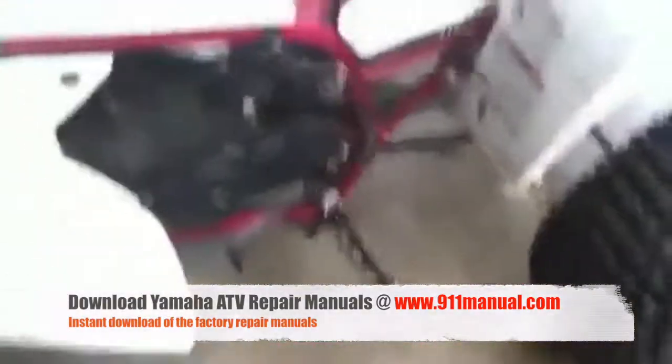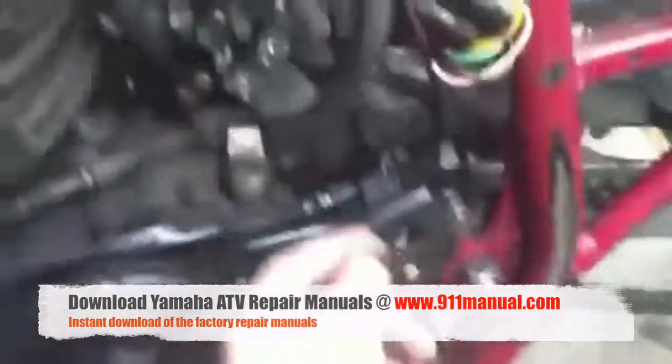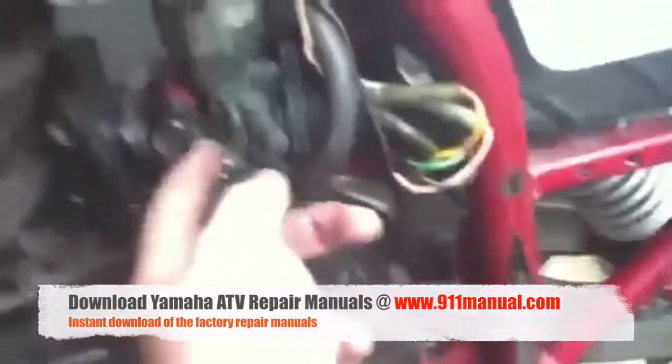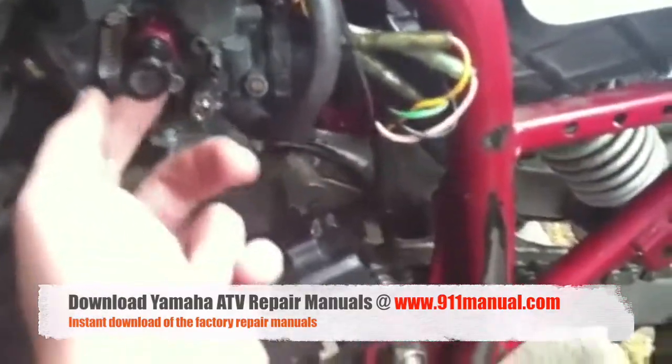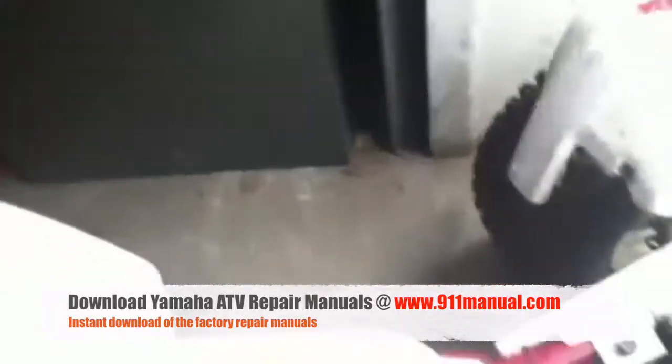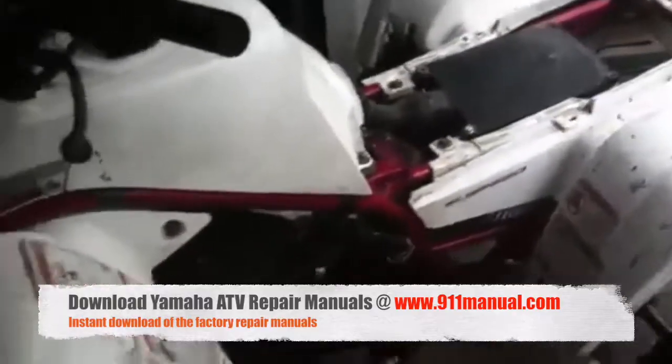Here's my blaster. I found out that when I would start it up and hold out the choke, it would be pissing air from somewhere — it was from here, because the guy drilled and threaded a hole in the carb for an idle screw. So I took an idle screw out of another carburetor, popped it in here, and the idle screw actually works. I backed out the throttle up top so now it has some play, and I got it idling from there, which is good.